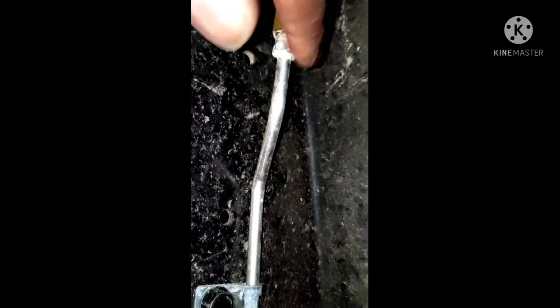So if I got fluid here when I take this loose, or fluid there, I might take this one loose. But I got fluid going through this union. I know I got it going all the way down to right there where it goes to both sides. So I know if that's the case, my problem is probably gonna be that rubber hose, gang. So I'm gonna get up on here, I'm gonna pull this loose, and I'm gonna see what we got. Alright?